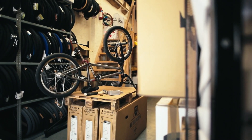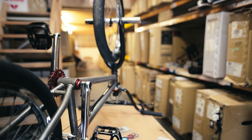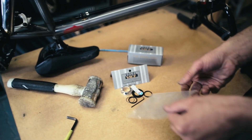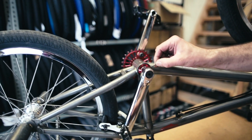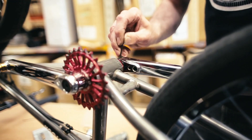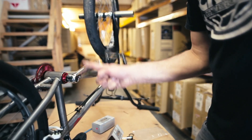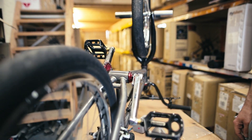How it works is you've got three grub screws on — it's like a bottom bracket — it'll replace your current bottom bracket spacer on your left hand side, or right hand side if you're riding opposite. You've got three grub screws which screw onto a clutch washer. The clutch washer pushes against the bearing on the bottom bracket and slows the cranks down. You don't get any spin back — it's all good.